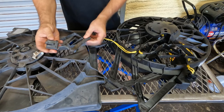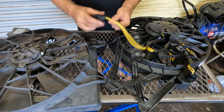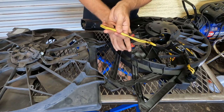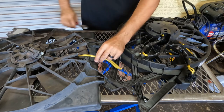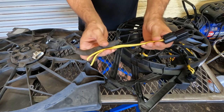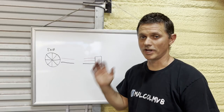Let's talk electrical on our Mach 8 fan. We came with a pigtail harness from the junkyard — you can see it's got two wires with the correct connector to go into the Mach 8 fan. The factory fan we pulled out also has a pigtail with three wires — we're going to cut this off. We'll have this connector that goes into the factory harness under the car and join them together to make a jumper harness from the Mach 8 fan to the factory harness without cutting any under-hood wires. There are three different stages: stage one super simple, stage two a little more advanced, and stage three a lot fancier for people who like digging into electrical.